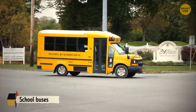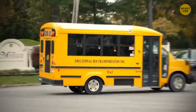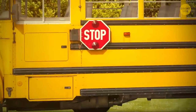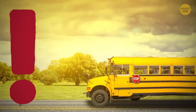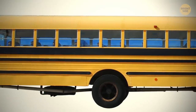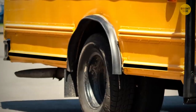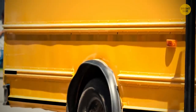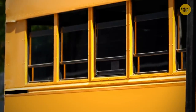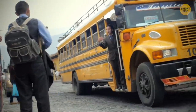Black stripes on yellow school buses aren't an element of design. They're metal rails put along the sides and back of the bus to protect its rather thin walls — in case of a collision, they absorb most of the force. These rub rails are positioned strategically: the lowest runs at floor level, the middle matches the bottom of the seats, and the top corresponds to the top of the seats or bottom of the window.